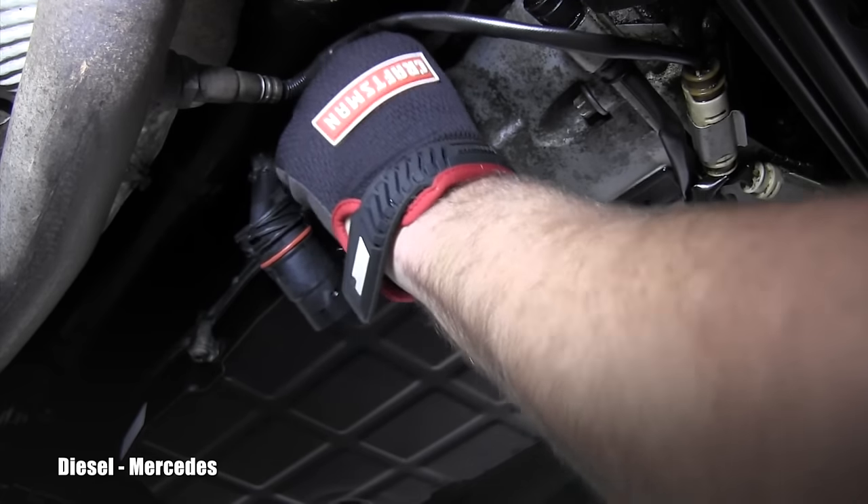I am carefully and slowly pouring that fluid. The evacuator removed approximately three quarts, which is about three liters — the amount sitting in front of me. But we also don't forget there was a bunch of oil left in the pan, so I will go ahead and put in three and a half quarts. After that I will start making measurements using this dipstick tool.